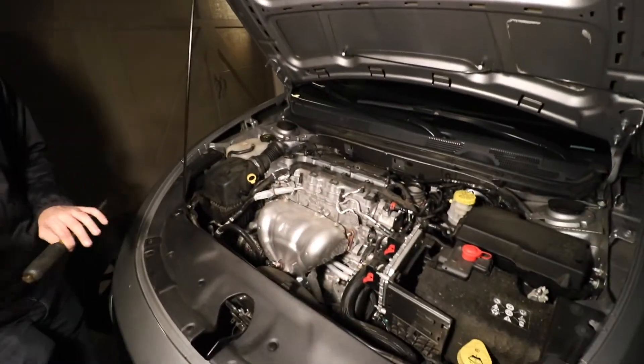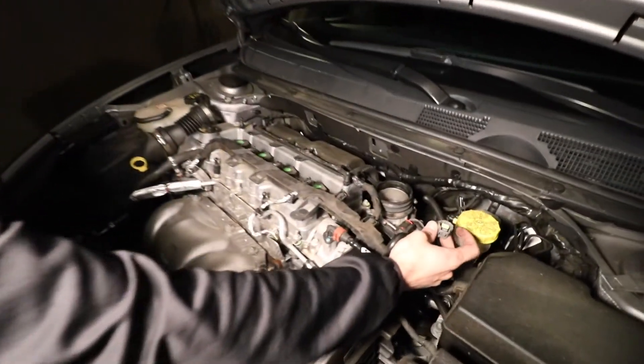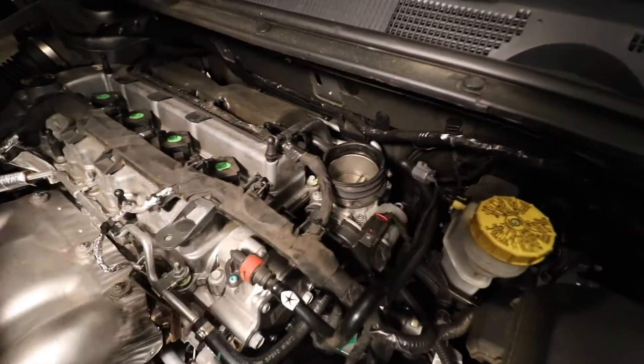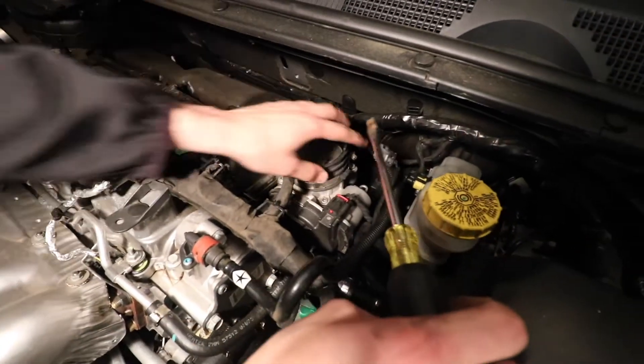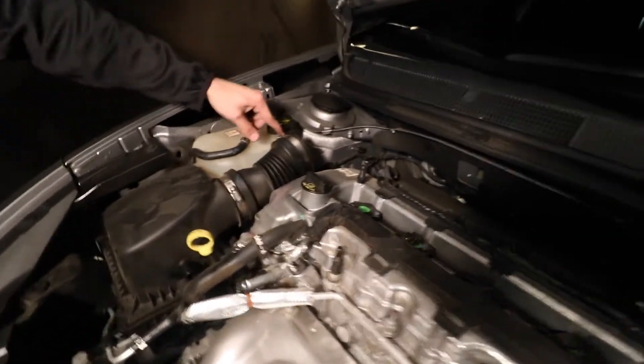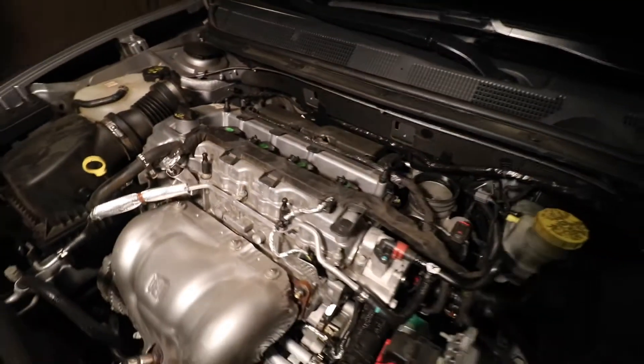We took that front cover off. In order to do that, you have to go back here and unplug your mass airflow sensor. There's going to be a little ring around here. You're going to have the screwdriver and you're going to untwist that little ring — just like these. You're going to untighten that so the whole thing comes off. You're going to loosen this one up as well, just pull it back. That whole back piece will just come right off the top.